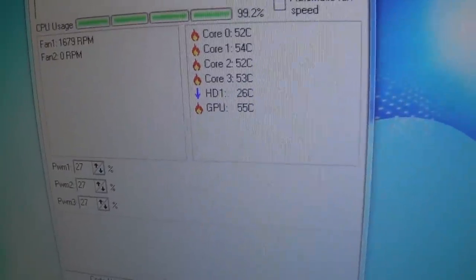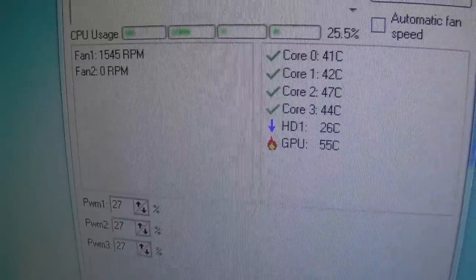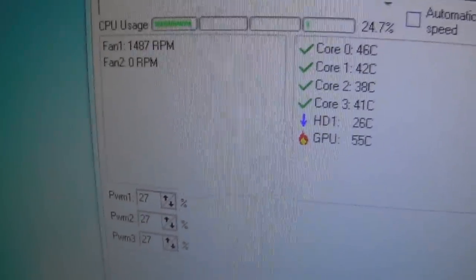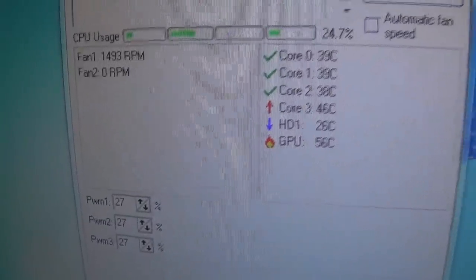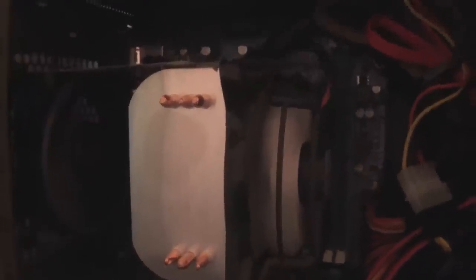It's just going back to idle temperature. The graphics card is at 55°C because it doesn't have a fan — it's one of those with just a heatsink and no fan, so they tend to get pretty warm. But my main concern is the CPU which is doing really well. I think that's been a good upgrade — certainly worth the £17 I paid. My computer no longer has that buzzing noise the old cooler had. That's been an installation and review of the Arctic Cooling Freezer 7 Pro. Thanks for watching.